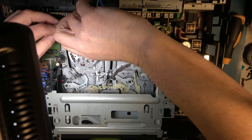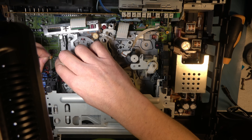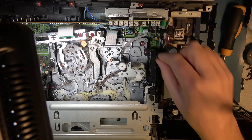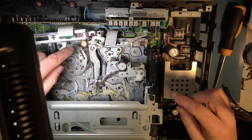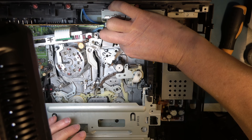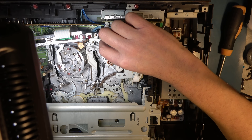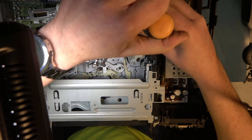Now let's disconnect it all. We have the head amplifier cable at the top, there's an erase head cable, an audio control head cable, and a deck flexi cable. On some decks with this K mechanism there's a transistor mounted on the back right that uses the deck as a cooling heatsink, so you may have to unplug that. Unplug the head motor cable from the PCB — unless you've taken the head amplifier off anyway, as the connector goes underneath that. It's a little awkward to get to, and in this particular case we seem to have a fourth screw — wasn't expecting that.